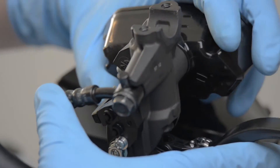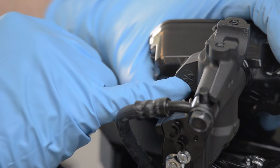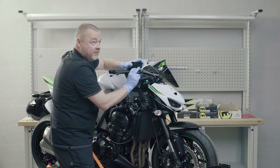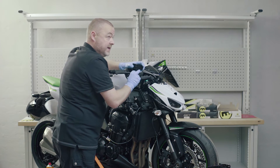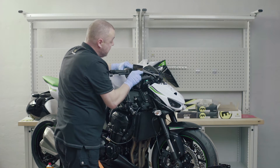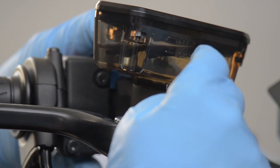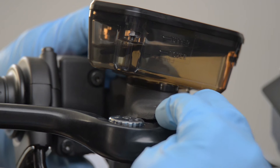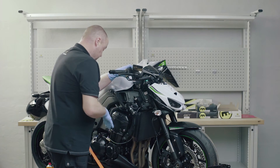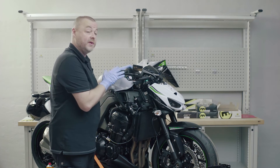I can see it's three quarters of an inch, and three quarters of an inch — with an inch being 25.4 millimeters — is 19.05 millimeters. In this case, the mechanical leverage ratio on this master cylinder is slightly less than it is on the HC1, so for the 19 we are going to use an 18 today, which should be the perfect master cylinder for this particular motorcycle.